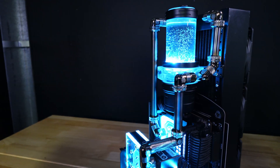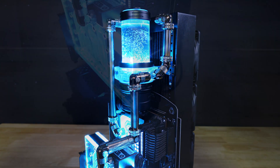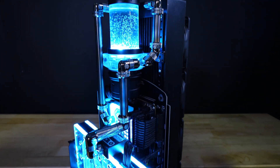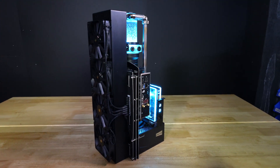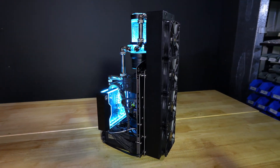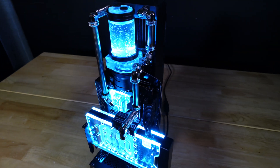This is actually quite a high-end build — it has a 13900KS and a 1000 watt power supply, which is why we have the 480 millimeter radiator. It's kind of needed for these very hot components. But the temps were really good because of the completely open design, and it's also a good amount of radiator capacity. It can pull plenty of air through the layers of the Phantom, as there are gaps between all of the layers.